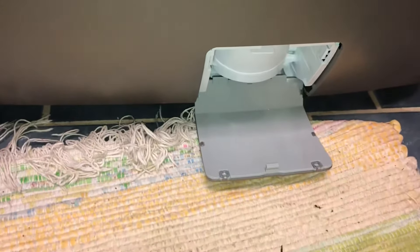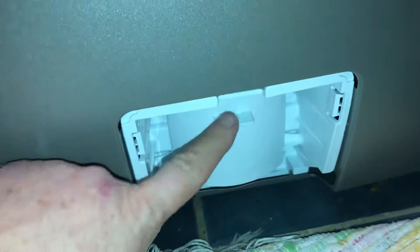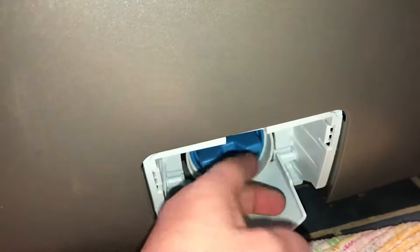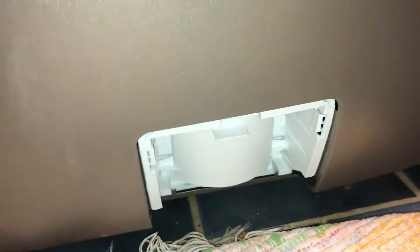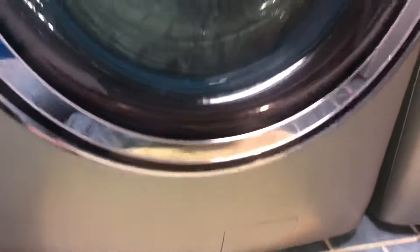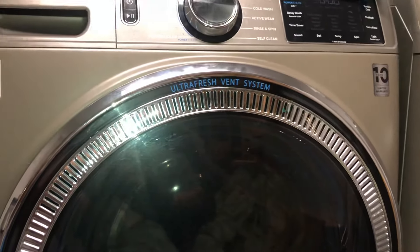Once again, to get it out: go to the bottom of your Ultra Fresh washing machine, take a flat knife or screwdriver, there's a little ridge — pop that out. Then go down here and feel for the door since you can't see it from above. Pull it down, unscrew counterclockwise, clean it out, and put it back in. You will have a couple cups of water come out, so be prepared to sop that up. Set the cover on the ridge and push it in — snap it into place. And that's how you clean the lower lint filter on your GE Ultra Fresh Vent Washing Machine. I hope that helps somebody. Have a great day and thanks for watching.